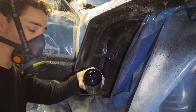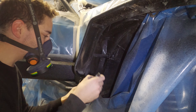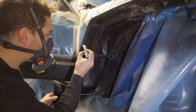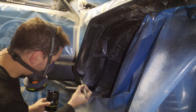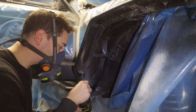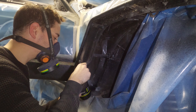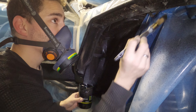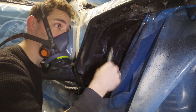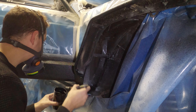One little tip I can give: this is the bottom of the three bottles I've used. I've heated it up with the diesel heater and drained it into the bottom of this bottle, and I've got a brush. While this has been sitting now for about 30 minutes, it's not going to smudge. So once you've just sprayed it and you do this, you'll lose the texture in that spot — but after 30 minutes I won't lose the texture anymore. It just means I can go over areas I've probably missed with the Raptor gun, because the gun is just super inaccurate, and touch up spots without wasting the last bottle.